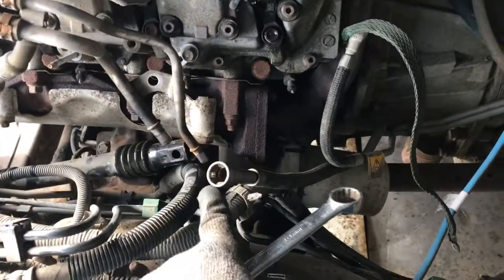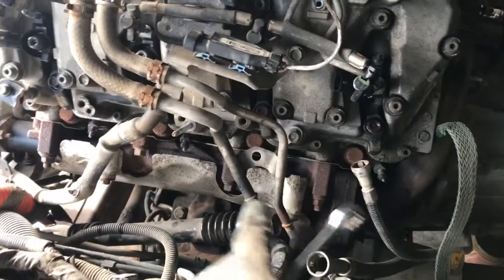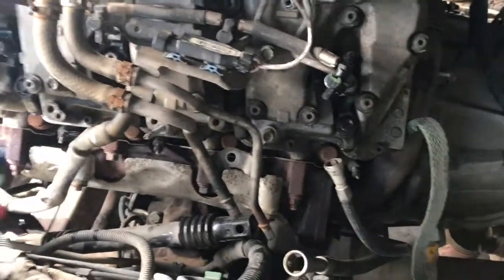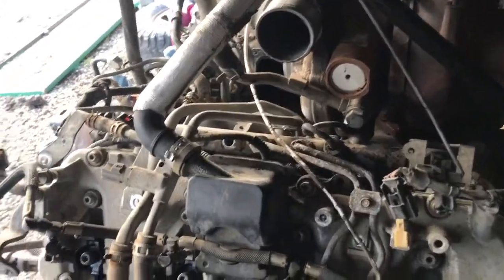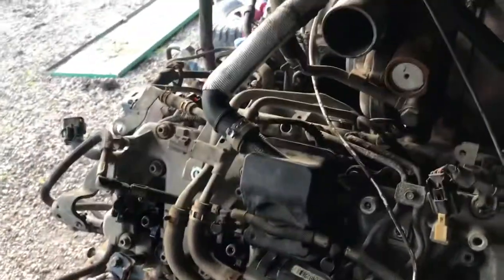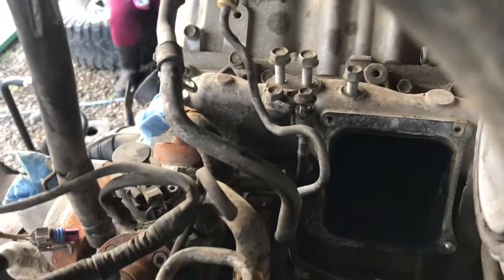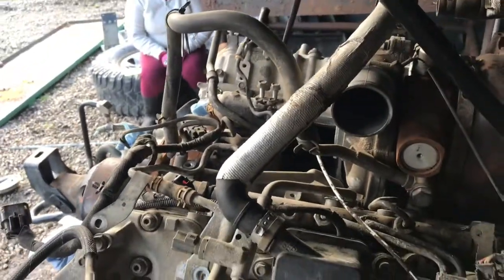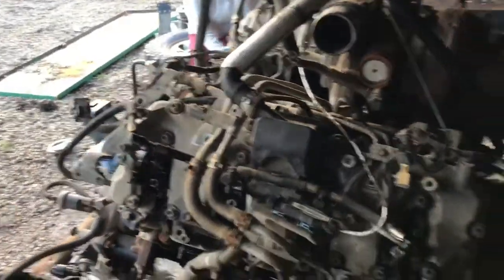I'm thinking I'm going to reroute all the fuel lines — the feed and the return come up here and then up over the head. I might just reroute them to come along the front of the engine, maybe mounted over here somewhere, and run it straight up and over to the pump instead of coming up and over down into the valley. It would just make more sense to me. So if I'm bending tubing anyway, I'll go find some half-inch stainless tubing, plumb it in right to the pump, and hopefully find a Swagelok fitting to convert it all over. That way we'll for sure have no leaks because it's rated 25,000 psi.